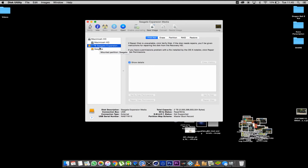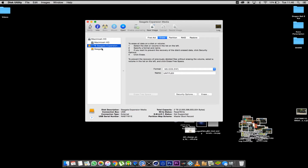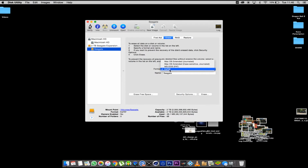I made a mistake. I put some annotations on the video anyway. When I did the unboxing for this, showing you how to format it, I did it on the top one. But basically, if you just follow the same steps but click on the bottom one first, that's all I did, and it doesn't really mess it up a lot, but you can just come back again and do it there. So if you just click on the bottom part of the hard drive, so with the partition of the hard drive there, go on Erase and then click on the format exFAT.